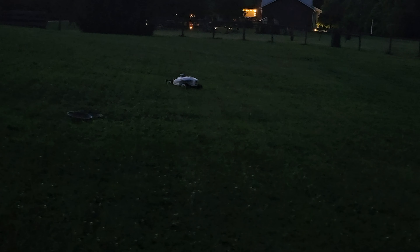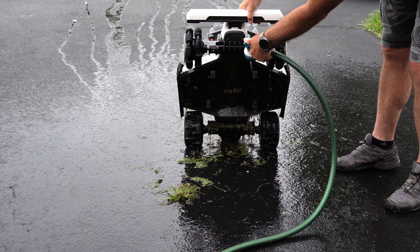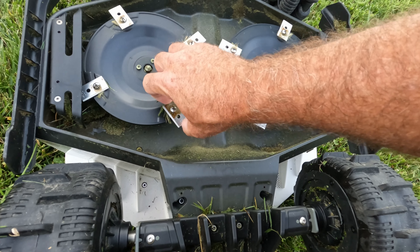Just be aware you can actually do that and it doesn't take as long as I may have originally implied. It is able to mow at night just fine and your neighbors will never know it's running because this thing is super quiet. But having it mow in wet grass will mean you'll have to thoroughly hose it off once a week and spray out that undercarriage to remove any wet grass clippings that will accumulate, especially around the cutting blades. Also, you'll need to flip the cutting blades around every few weeks and replace them every couple of months. It's a super simple process taking about 10 minutes, and they do provide a replacement set of blades in the box. When you do have to buy new blades, they're not crazy expensive — about $16 a set. If you have trees that drop significant amounts of large leaves in the fall, you'll want to keep those raked, since this mower just won't have the power of a full-size mulching mower.